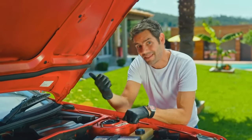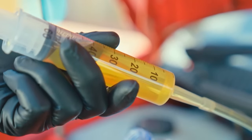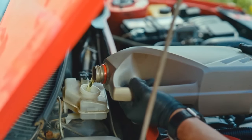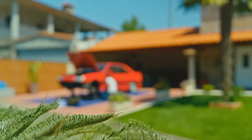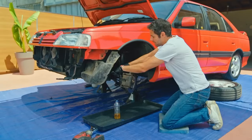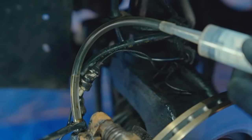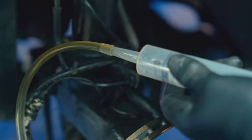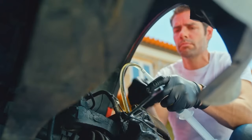That means I can change the fluid in the front end and then move on to the rear. Brake fluid can absorb moisture from the atmosphere, and if it's left too long it can corrode the brake system from the inside. Once the fluid's been replaced, I need to ensure there's no air in the system by drawing the fluid through the brake lines. With fresh fluid in the reservoir, I'm gonna use this syringe to drag that fluid all the way through the system and out through the caliper. I need to keep an eye on that reservoir and make sure it's topped up - the last thing we want is for the reservoir to empty out and air to find its way in. If pockets of air were to enter the lines, then when we hit the brakes we're only gonna get a portion of the usual stopping capability. And in a car that packs as much power as this 405, that isn't gonna be good.